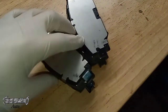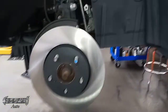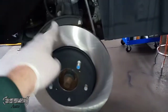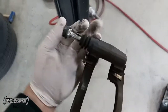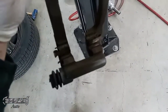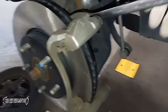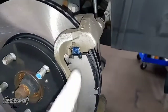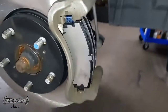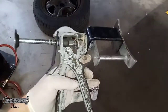I've got my little wear sensors on top and my shims on. Now I'm going to put these pads in. If you get aftermarket pads, the shims usually come already attached. I cleaned off my new rotor with some brake cleaner and a rag, since they sometimes have packaging grease on them. I lubed the slide pins and took a wire brush to clean the hardware on the caliper bracket. I put the caliper bracket back on and got those nice and tight — torque specs are in the description. Once the caliper bracket is tight, we put the new pads in. The little spacer sensors go on top to help prevent shifting.